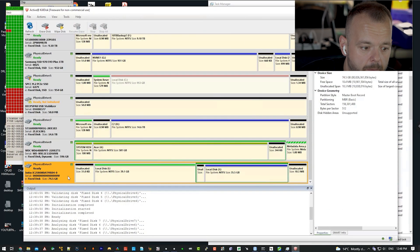For SSDs, a single pass is enough. Yes, there are unused memory pages with some data left behind, but even people in this industry won't be able to access those pages. And most SSDs are encrypted anyway, so you'd just get scrambled data from an unused page. If you want to be extra sure, wipe the drive twice, or just enable encryption on the SSD first and then wipe — data's gone. Now let's jump into the computer and I'll show you how to wipe using Active Kill Disk on Windows. The drive shown is the 80GB one.